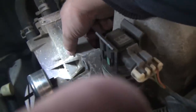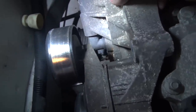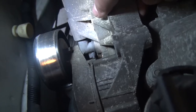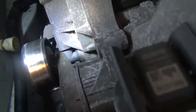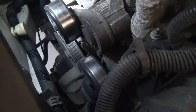Now that we've got all the fasteners out of here, you can see that this bracket is now loose. The only thing that is holding it is those plastic elbows down there. Now we want to pop those out ever so gently with a screwdriver or some other prying device so that we don't mar the aluminum that they go into. We need to make sure we don't dig at it because those do need to reseal, and aluminum — if it's scratched — will tend to leak.